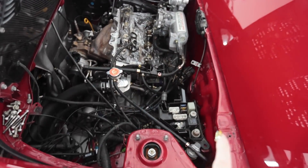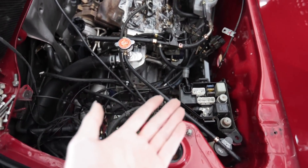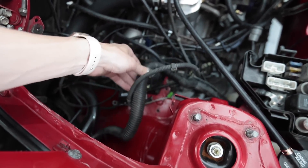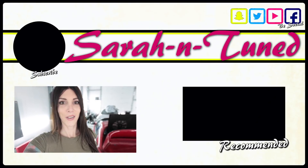I feel accomplished for this video. Got the old body harness out, the new body harness in, and it's all wired up and ready to accept the new ECU. Hopefully this is starting to make sense. Here are all the body harness wires ready to tie into the engine harness at the ECU, and the other stuff is going to route out back to the engine with the Link ECU engine harness that I build. I'm going to wrap all this up with loom and make it look nice and clean. As for the bay, it's not going to be entirely shaved — I'm going to leave stuff that serves a purpose but also make it look clean. The relays that used to be on this rear firewall are all going away. I'm going to keep the factory fuse box because it's functional and useful, especially having a power junction there. I want the car to still remain useful on a road trip — tucking all the wires and making it a huge pain to troubleshoot on the side of the road just to look cool is dumb. So I'll leave the main relay box and a few things accessible, keeping the car practical to drive. I'll see you guys soon with another video. Bye!